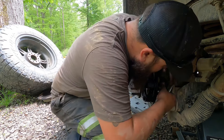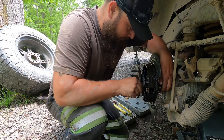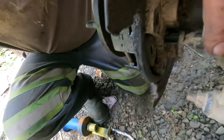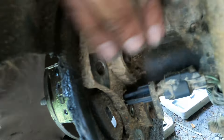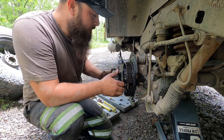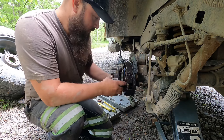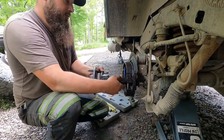The sensor is wanting to be a little stiff. There we go, now it's moving. I'll get you in here so you can see. I'm just taking it out just enough to where it ain't gonna cause no issues getting this little retainer past it. When you pull this axle out, oil can come out — I got this thing jacked up so high and I didn't drain it, which would be the good thing to do. The slide hammer just slid it right out.